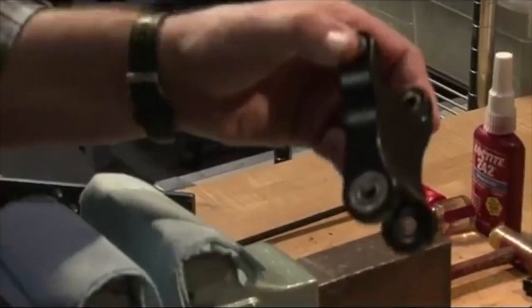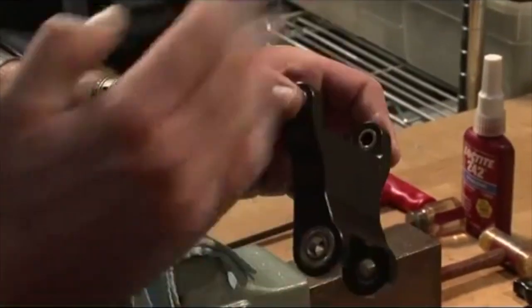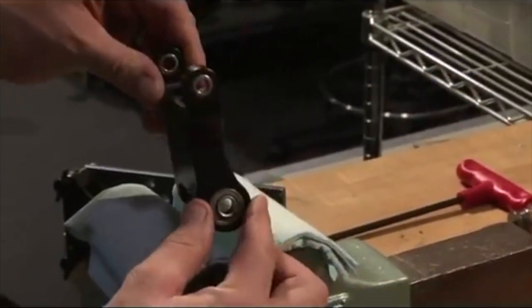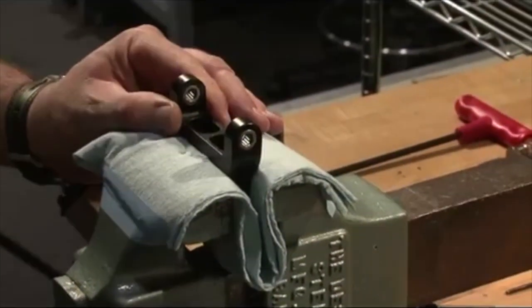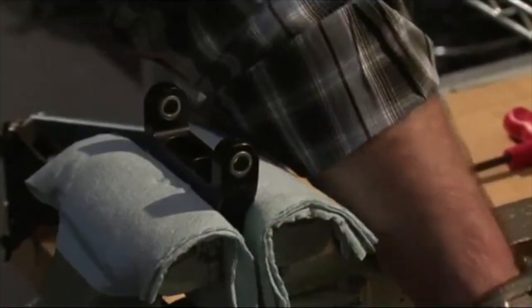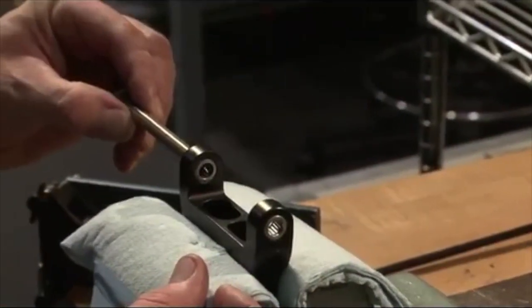All right, here's how we begin. You'll need your socket block adapter. It has a flat side and it has a concave side. You need the concave portion facing that direction, like so. Tighten it down in your vise. You're going to pick up this pin, that washer with that retaining ring on it. You'll insert it right here.